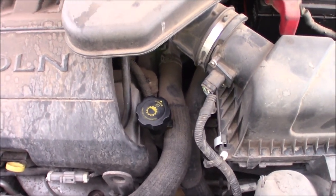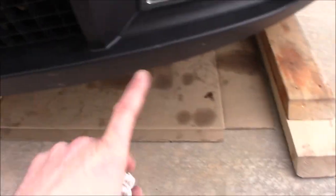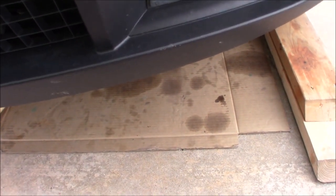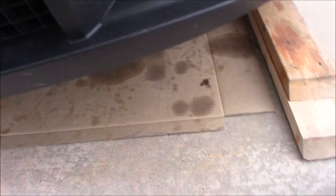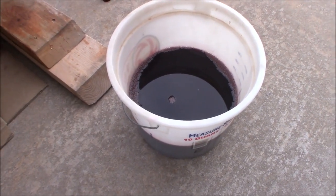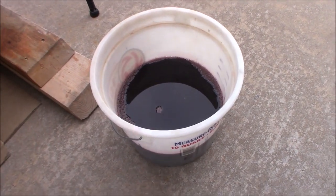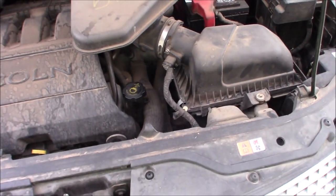That's about all I've got. The drain plug is located just straight down underneath on the driver's side — right up under, you can't miss it. Bottom of the transaxle, little 11mm head on this one. Make sure it's cool so you're not measuring expanded volume, so you get an accurate measurement for how much to put back in. And make sure you remember to add it back before you drive off — because that will ruin it quicker than you can imagine.